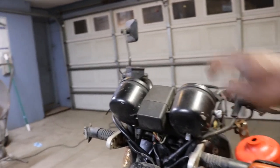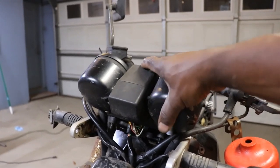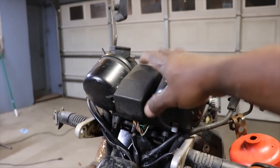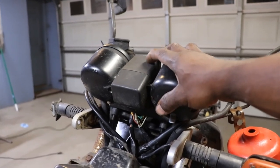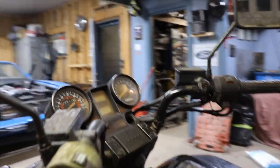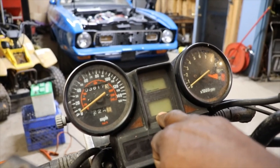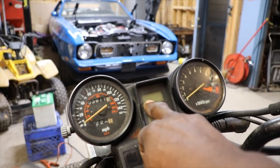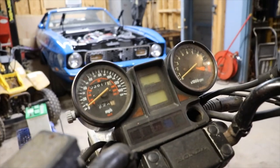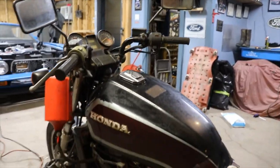And I'm thinking about taking this gauge cluster apart. I cannot find one. I'm thinking about just taking it off, taking it apart, and we'll clean it out, clean all the connections, because the RPM gauge doesn't work, and your gear selector, gear position don't work, and the temperature gauge don't show up. So I'm thinking about just taking it apart and we'll clean it. Maybe that'll bring it back.